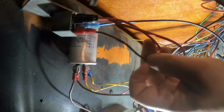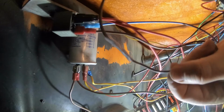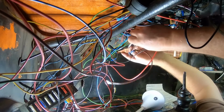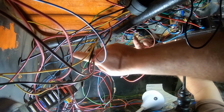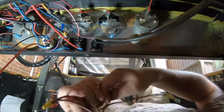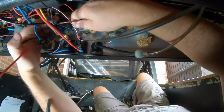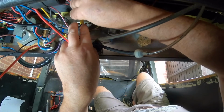Here we have an earth wire. It's brown, which is good, but it has multiple connections like this between the relay and the headlight. So here's another problem. Brown into red. The red becomes brown again and becomes blue and red. That's got to change as well. I've made up a connecting loom for these instruments to earth them. Fuel gauge, voltage regulator, and a clock which is not powered because presumably it was draining the battery, so it was simply cut off.